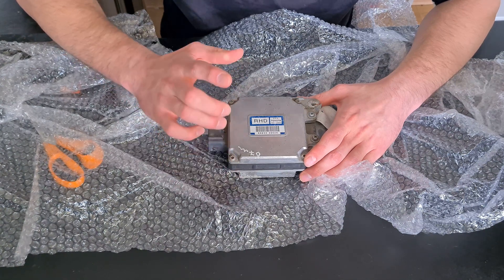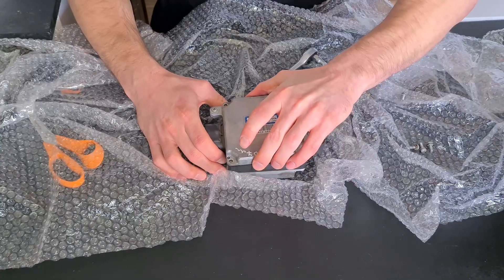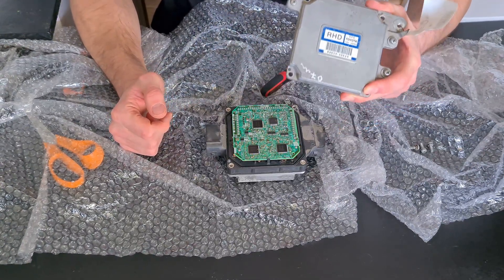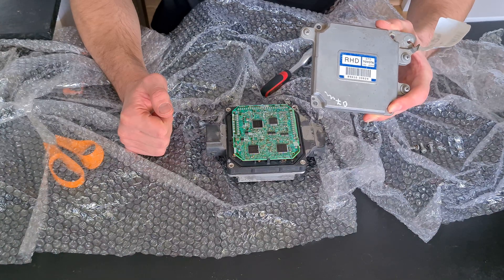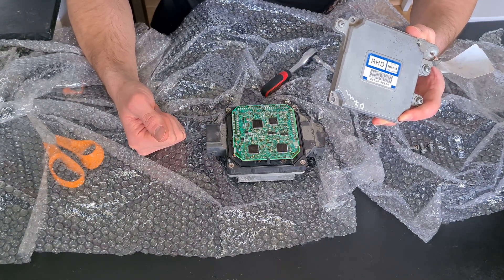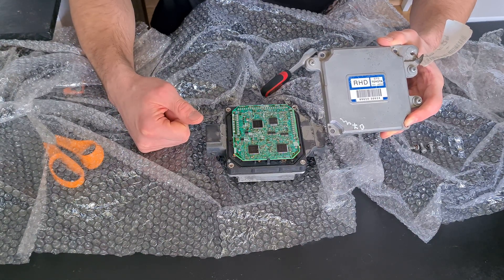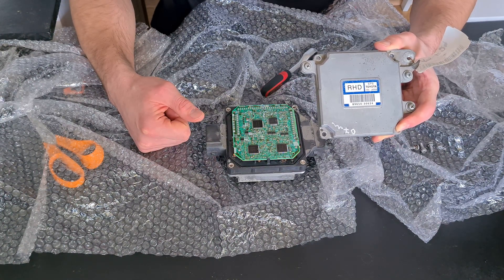Let's see what happens. I'm going to try to open this up and see whether changing the lead itself is simple. This is promising to begin with — this is literally the only physical difference between the left-hand drive and right-hand drive power steering ECU. So now I need to pull it out of the car, compare them side by side, and see if I can get away with just changing the lead and plopping in the right-hand drive ECU.